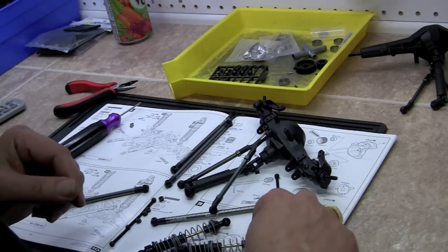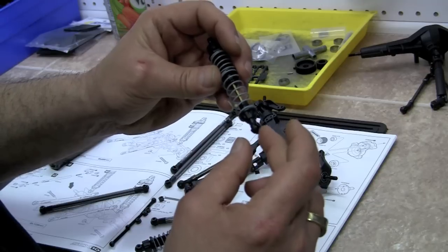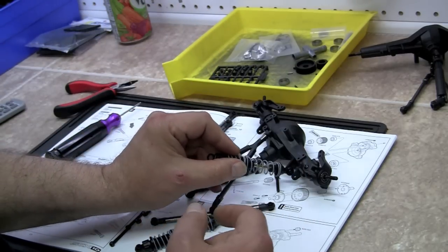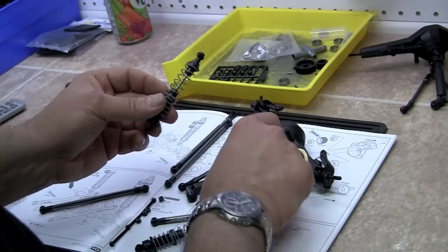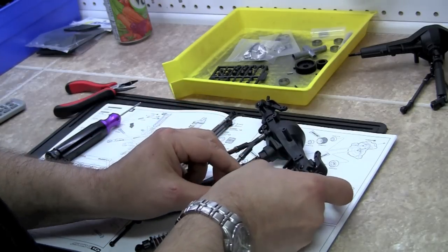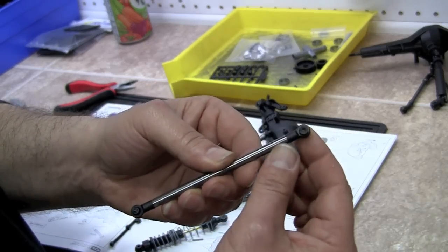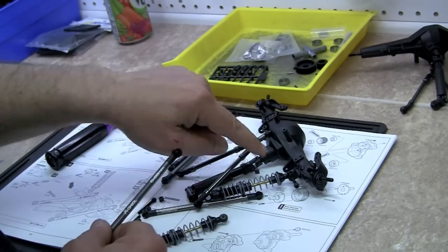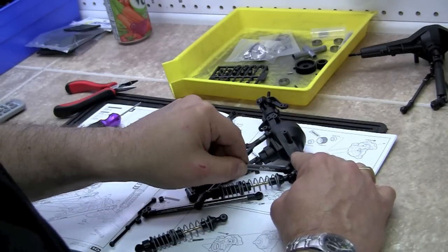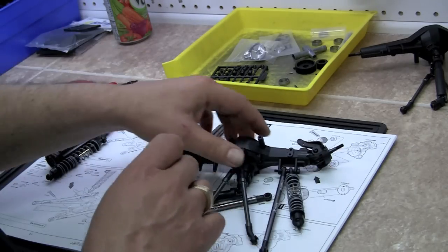So to do this, as we look at the directions, we want to use the shock and put the perch end down — that's not the cap end, it's the perch end. We're going to put the flanged portion of the little knobber jobber to the outside so it rests against the outside of the little holders. I'm going to partially insert the screw and put the shock in — the shock goes to the outside. Then we're going to take our shorter of the four shafts that we built, and again the little knobber jobber is going to face towards the flange, so we have the flanges both towards the outside on both of these. I'll slip that in next to the shock, slide the screw all the way through, and then put a nut on.